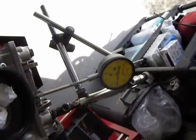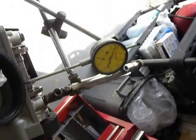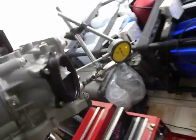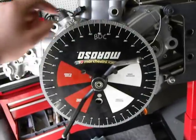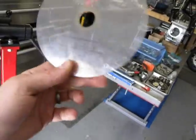Make sure I get it exactly right. It's a little tough to do this with a single hand. You've got to go back — you've got to always try and go in one direction. That's at zero. Actually it's after bottom dead center. And that will show me — this is my bottom dead center mark, which on this degree wheel, which is a 180-degree wheel, which is optimum — the best is to have it set up where you have 90 degrees on either side.